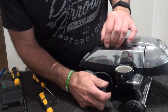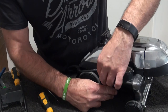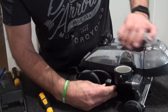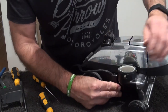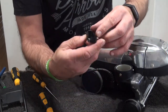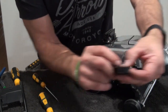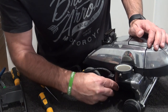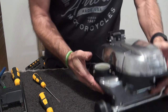She's barking at him. So sorry about that. Right, so we've got our lead in. This bit just lifts in. Make sure it slots in properly. It's just a kettle lead in the day. Push it forward and then back. I'll show you again. There's a little lug just there that has to slot in, so you get that in first and then you push it forward and then that lug slots behind it. So again, going straight like that, push it forward and then back. Okay,